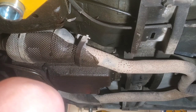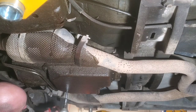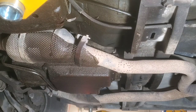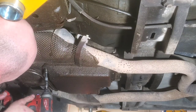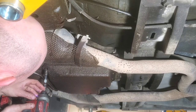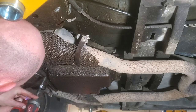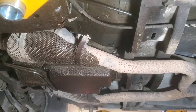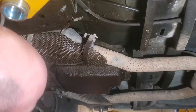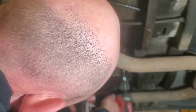All right, got only 4 bolts left in here, so I'm going to start by just loosening these bolts over here. On the transmission pan, I did notice that it started to come down. Now this one I'm going to take completely out. Actually, never mind. I don't know if you can see in the view, I got this big wide pan. It's really nice to have something like that. I used to use a plastic garbage can lid, cut a hole or drill some holes in the bottom of it so no bolts fall through it. Stick that over a bucket or something like that.